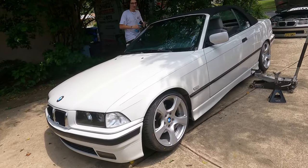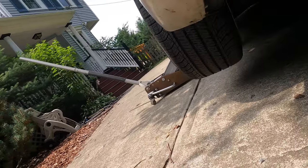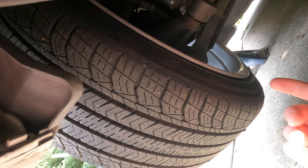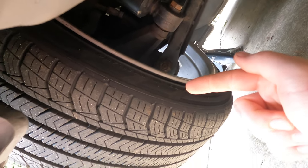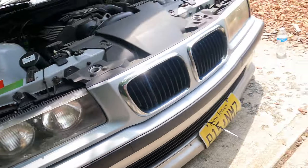When you build an E36 properly, you'll know you're doing it right when you jack up the back and that front tire is off the ground. If you don't want camber on your car in the rear, to do it you loosen this nut, turn the bolt, and then tighten it back up when the wheel is straight. I'm gonna get started on my headlights now.